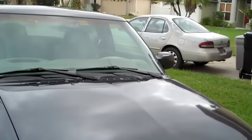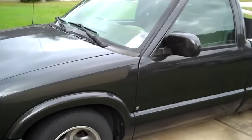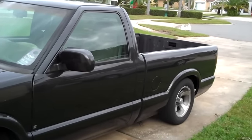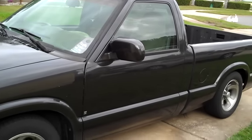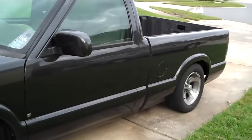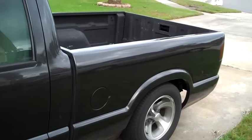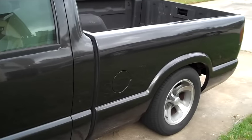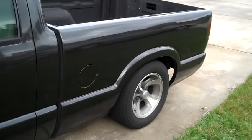Today I'm working on this truck. The other day I went to start it to go to work and it would not start. It was cranking over just fine, but I couldn't hear the fuel pump engaging and it wasn't backfiring as I tried to start it — indicating it's not getting fuel. I checked the fuses and there was no problem. It started right up this morning, which tells me the fuel pump is probably working intermittently and getting ready to go out. So rather than pay for a fuel pump and a tow bill, I'm going to go ahead and change it.